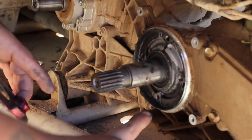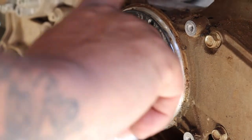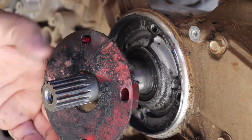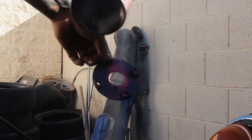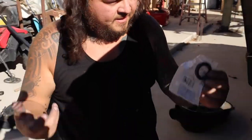This is the seal that got taken out back here — it started leaking transmission fluid. I'm basically going to spray this off with some brake cleaner to clean it up, take out the old seal, and inspect the shaft to make sure it doesn't have any major nicks on it. I already took the plate off in advance — going to clean that with brake cleaner too, get the new seal installed, and then put the Salvo Racing plate back on to protect that seal.